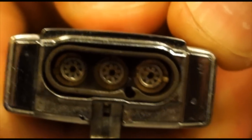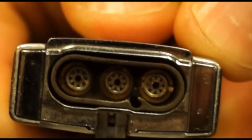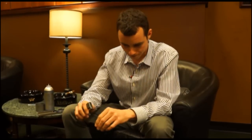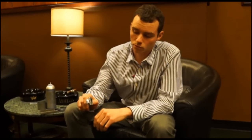So if you're having problems with your lighter, take a look at it — when you pull down, look to see where the spark is. Sometimes you'll see it arcing off the back of the lighter, not off the jet at all. When you're looking into the lighter, make sure you're not too close, just in case it does happen to light. I don't want to see anyone get their eyebrows or anything. With this one, the metal piece is bent up too far, so it's arcing off the back of the lighter.